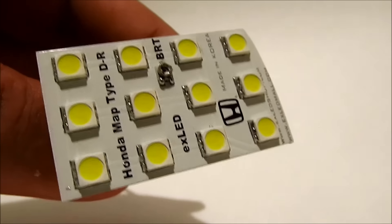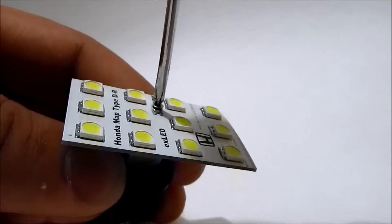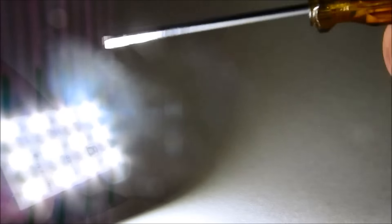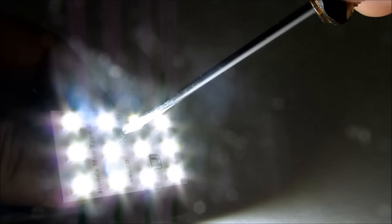It's really bright. To adjust it, you see this little knob right here — you take a very small Phillips screwdriver and you put it in this hole and press it down, then turn it and it'll adjust the brightness. If I turn it left, it'll get brighter, and if I turn it right, it dims down.